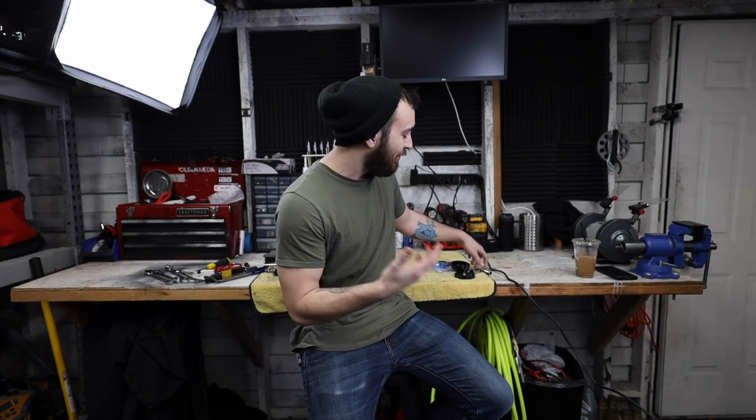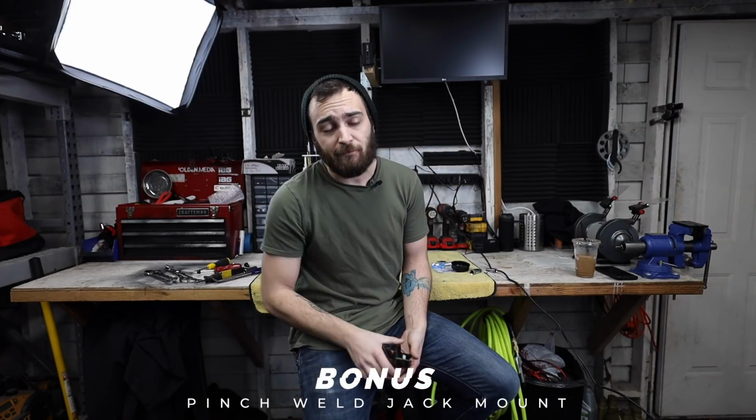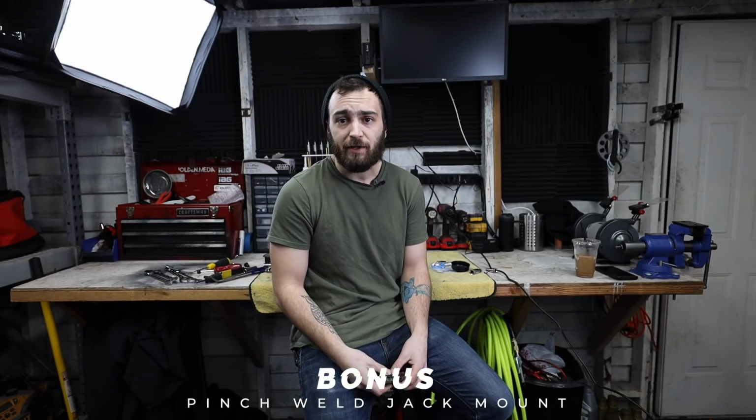Okay, so as I grabbed some of these tools, I kind of realized they're not all just Subaru specific, but these pinch weld jack mounts are a lifesaver. I work in a very small garage out here. It was built in like the 60s, so I don't have a lot of width in here. So this thing comes in handy when I have to use a small jack to be able to get under the car. Use your pinch welds, just make sure you're using them right.